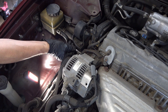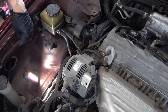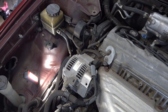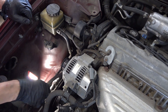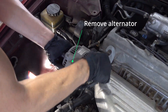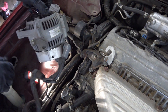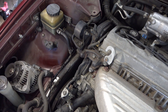There is a 12mm bolt here in front of the alternator, there is a 14mm on this side, and there's a 10mm holding the expansion tank. Once that tension is released, the alternator belt can come off. At that point the alternator can be removed.